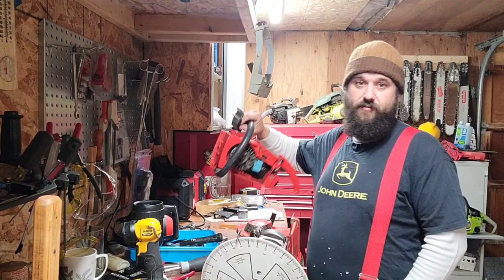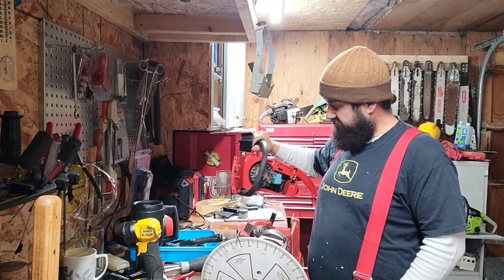I think I'm going to go more radical on this one, just because there are some differences between the 130 and the 76. The 76, from what I can see, I've got a few of them here now to measure. They need a lot more work to rock and roll. So on the 76, I'm going to do some pretty heavy machine work on the transfers and exhaust port. You guys will see. We're going to go right into that thing. But I want to get this one done first.